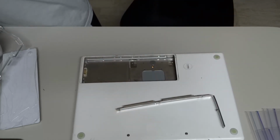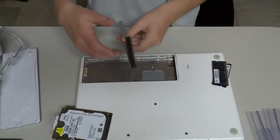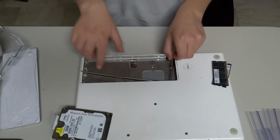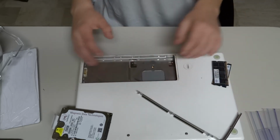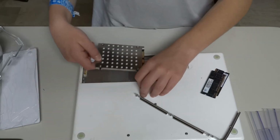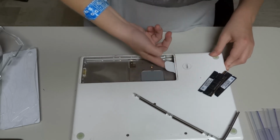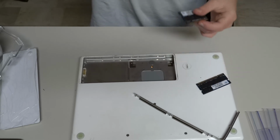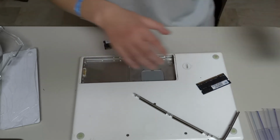And it's very simple. So the bezel's seated in here. And then you're just supposed to undo these 3 screws here and take that out, and then you pull these back and the RAM pops out. So you're going to go ahead and slide our 250 gigabyte drive in place. We're going to fold that tab back. Then we're going to install our RAM.